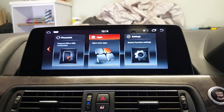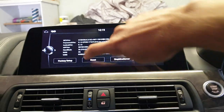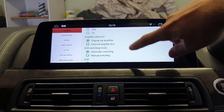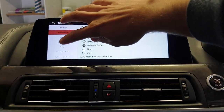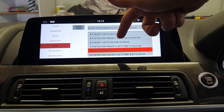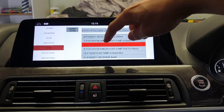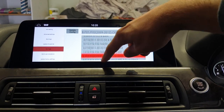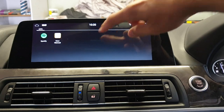From a technical point of view I had to change some deep settings. Going into factory setup — the iDrive controller doesn't work in this menu either — you choose what kind of system you have, and when you go into the car type, technically my car should be the F1X 2011-2012 CIC 8.8 1025, which it was set to by default. But whenever I went back to the car system some elements were cut off the screen. The only way I could fix that was changing it to an F1 F27 series CIC, which only came with a 1025 screen — a little thing, but you'd never know to look for it.